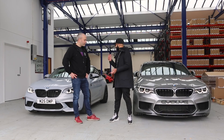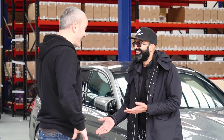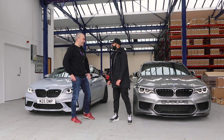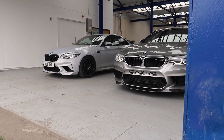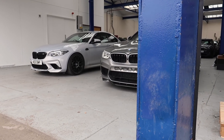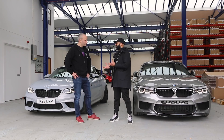The other good thing about them is you were complaining about maybe the car's just a touch too low and you're stuck — you can't do anything, although it looks good. Occasionally I get a bit of scraping on the front. With the MSS the beauty of it is that you can actually run it at stock ride height. If you want just the handling aspect you can have that, but if you want the aesthetics you can have that too. And you're not stuck — if you want 30mm lowering and it's catching on your driveway, you can quite easily use the height adjustment on them to raise them back up.